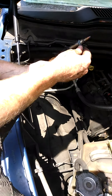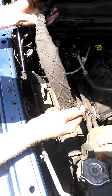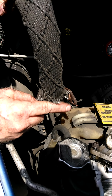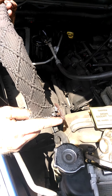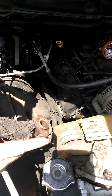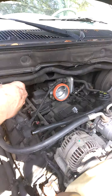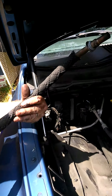Back here — what I did was unscrewed the two screws at the EGR valve. Now, make sure you soak those with penetrating fluid like a day in advance. Do not try and take these two bolts out dry — they break a lot. There is a lot of heat in there over the years, and if you have gone a couple hundred thousand miles, they will probably break right inside and you will have to get new bolts and get into trouble. But you take those out and then that will loosen this up. Up here is a clip — you lift this clip with a screwdriver, then you pull this out and now you have the tube off.